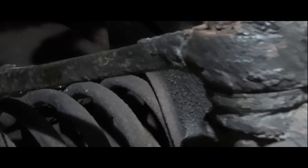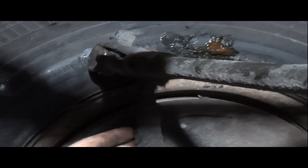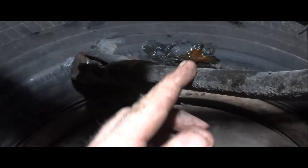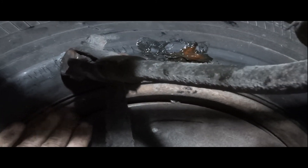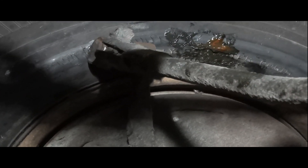Well, I think I may have caught a break actually. As I look closer around, I think I've got this figured out — I think they got the wrong rim. Either they have a different rim or different spacing on this one side. I'm somewhat relieved because I really didn't want to try to swap out arms or suspension parts. I wondered if they'd put on a different suspension part, but the way I feel this rim — I think we have mismatched or improperly mounted rims where the clearance is just too close. Maybe that's something we can fix relatively easy. Phew!